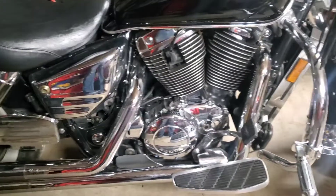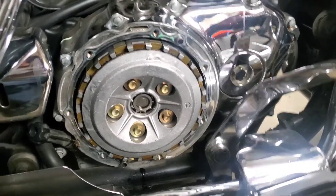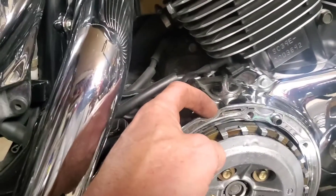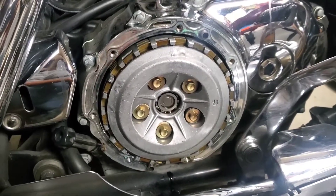I've taken the 7.5mm hex to get the cover off. There's a nice point here — if it's stuck a little bit you can just get behind the cover and pop it out with either a flathead screwdriver or a small pry bar. Just be gentle.